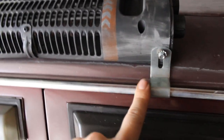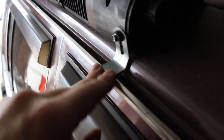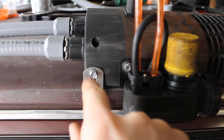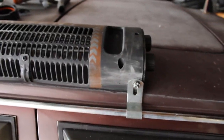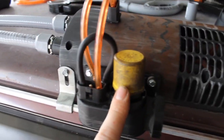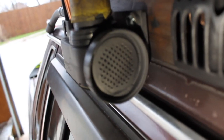Here's the mounting system I came up with. I got these steel 90-degree brackets - I found four of them just laying around. They hook into the rain rail on front and back and then drill into the side, and since there's wood behind here it's got a nice tight grip. That thing's not going anywhere so I should be able to still drive on the highway. On the other side I mounted it in between the sunroof and the roof so it's all nice and flat. I also added this cruise control module that came with the car - it was never hooked up, just in a box of parts. I added a relay and the wiring, used some excess tube from what we used in here. It doesn't do anything but it kind of looks the part.